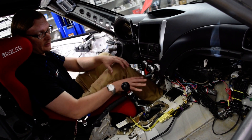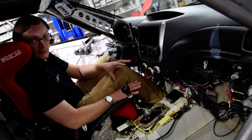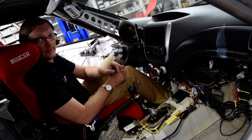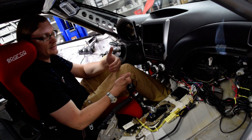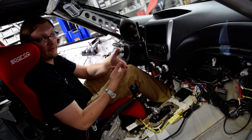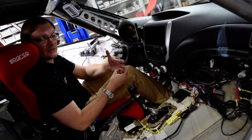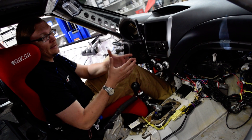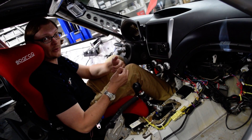A quick note about the DCCD controller — that's another question we get a lot. We're using the MAP DCCD controller, which we actually stock and is available on our website. We'll go into more depth with that in another video. Do you need a DCCD controller? The answer is no, you're not absolutely required to have one — it's recommended, but you can run the transmission without it. If you do not connect the DCCD controller, the center diff is going to be operating in full rear bias — as much as 65% bias to the rear. If you're in a part of the country where you get snow or slick roads, if you lose traction in the back, there's not going to be a lot of force translated to the front wheels, so it's going to behave a lot more like a rear-wheel-drive car than an all-wheel-drive car.